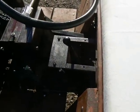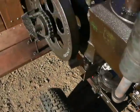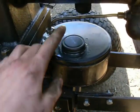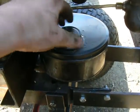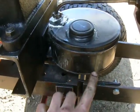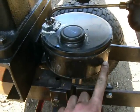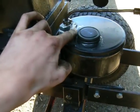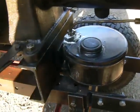It's a three-speed gear drive transmission. I made the gas tank out of a cookie tin — I soldered on a lid from a metal can so I can fill it with gas. I soldered all the seams in the cookie tin and soldered the lid onto the base so no gas would come out, and I made a little rubber grommet and RTV'd it on so the fuel line can go through and no fuel will splash out.